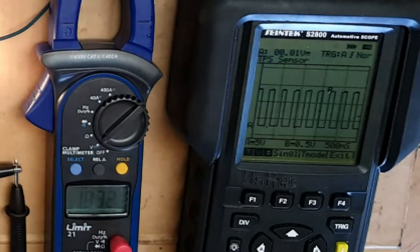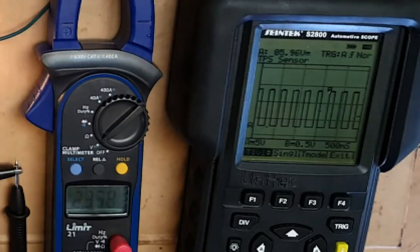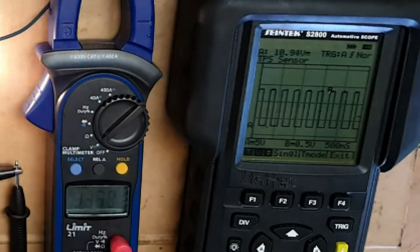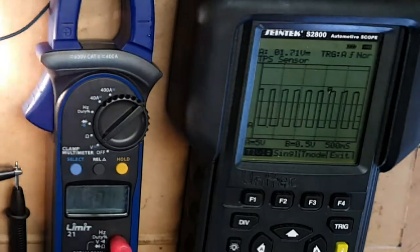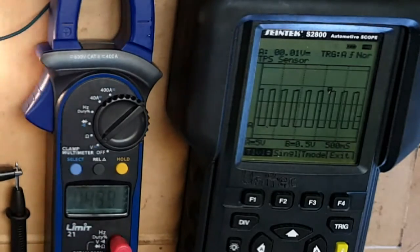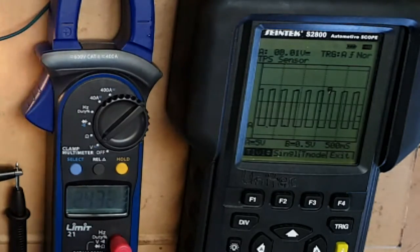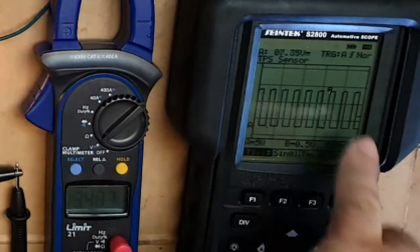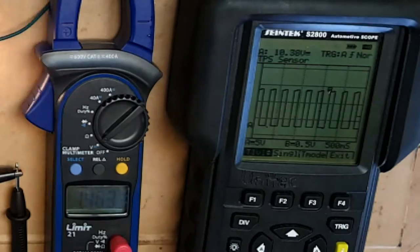The same goes for a crank angle sensor output. With a crank angle sensor, the ECU needs to know a particular position in the angular rotation of the crank. And again, they normally use a tone ring, but with one tooth missing, so that the point of reference is the missing tooth for the ECU. And we would see that very clearly on this screen.